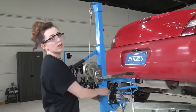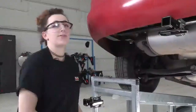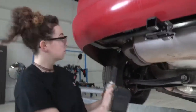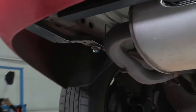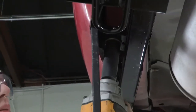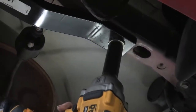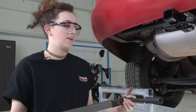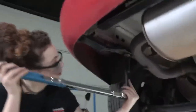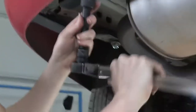Now that we have all our hardware in place, we're going to remove the U-Haul hitch jack and then torque all our bolts down. I'm going to use the electric drill just to snug them down before we use the torque wrench. We'll use the pry bar on these two just to get the bumper out of the way while we snug them down. We're going to use our torque wrench set to 75 foot-pounds with our three-quarter inch deep socket. When you reach the proper torque, you're going to hear that nice little click. And we're going to do that for all four bolts.